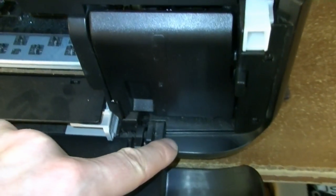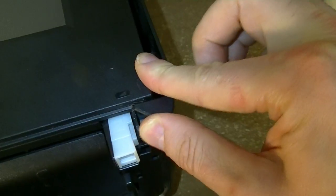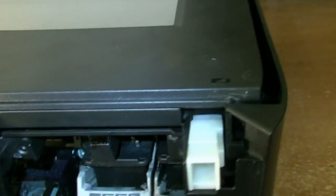Now on the right side of the printer, the side panel begins actually from here, goes around here like that, and goes all the way to the back. I usually take my fingers here, and already the snap fit that you can see over there got already loose, if you see that. That's not always the case, and what you can do to help this is the following. Push the plastic a little bit up. This will cause the locks from the snap fit to move up as well. And that way, when you move this panel down and to the right, it will easily go off.